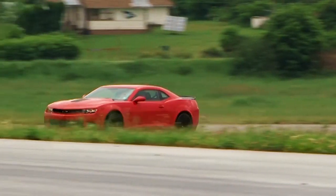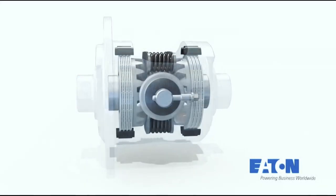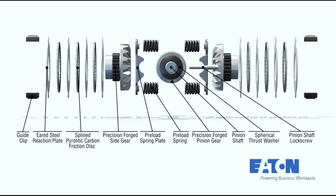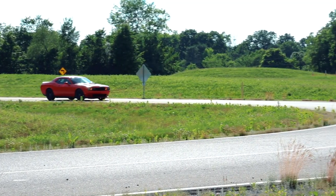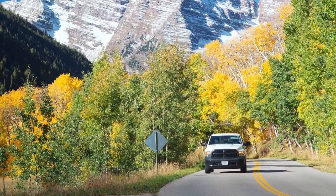The Posi is a mechanical limited slip differential that started in the 60s. Posi is short for Positraction, which was a name we used in marketing with a product we sold to GM, and it's gained a reputation in the performance car world. Posi is a wet plate type of limited slip — it can be preloaded with a pack of springs that enhances the ability to keep both tires spinning together. You're able to get tractive effort from both wheels when accelerating, which improves acceleration time and handling. Our customers really like the plate style for smaller or lighter loaded applications, and today it's currently in production on the RAM.